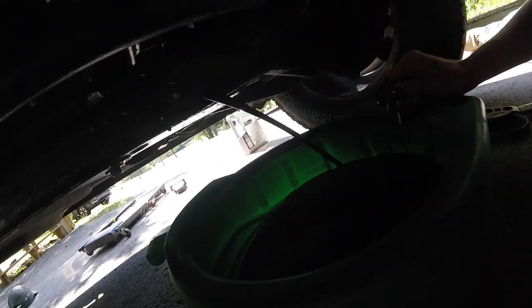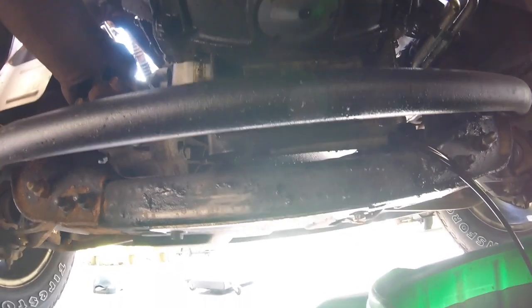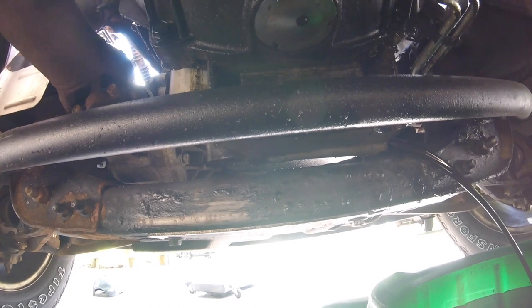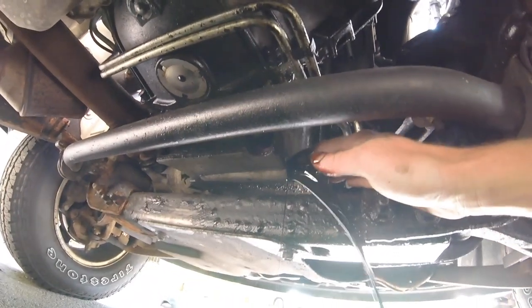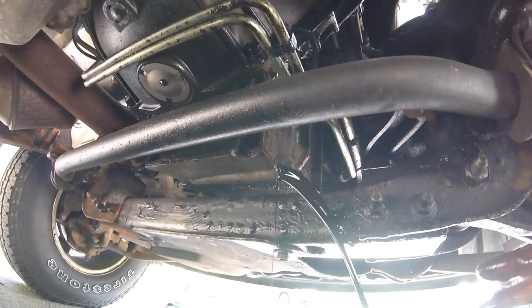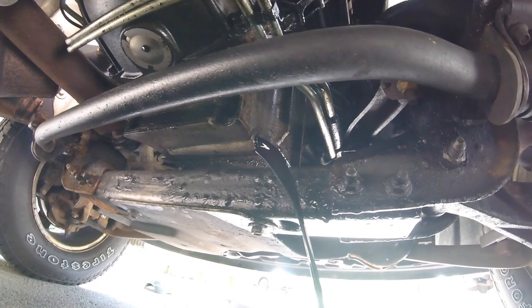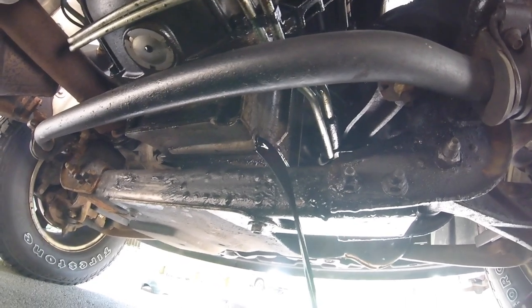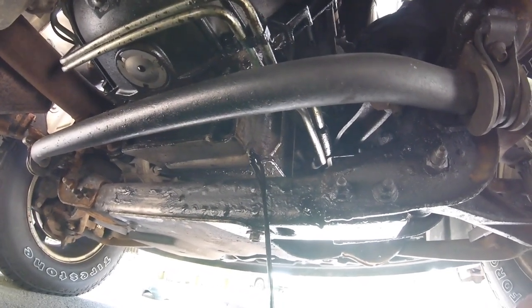So while that's draining, we'll let it drain. Up here, that white filter — that's our oil filter. We're going to change that too. Now there is a rubber O-ring right there — we'll look at it in a second when it's done draining. I typically don't change those, but you probably should. So don't take my word of advice there. If you go to buy your oil and they recommend buying one of those, you definitely should do it.